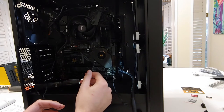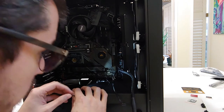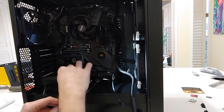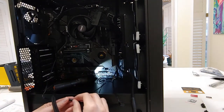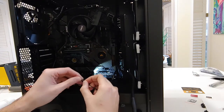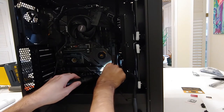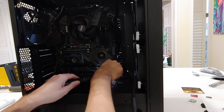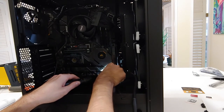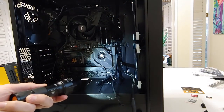And I got these two little guys. We got power LED positive, which is, wow, these things are tiny and in the dark. All right, that means I have 3 on the bottom. 1, 2, 3, we skipped that one. All right. So positive power is going to be the second pin from the right. And then the negative power is the one back here. All right, and there you have it. Those are all your top controls on top of the case plugged in.